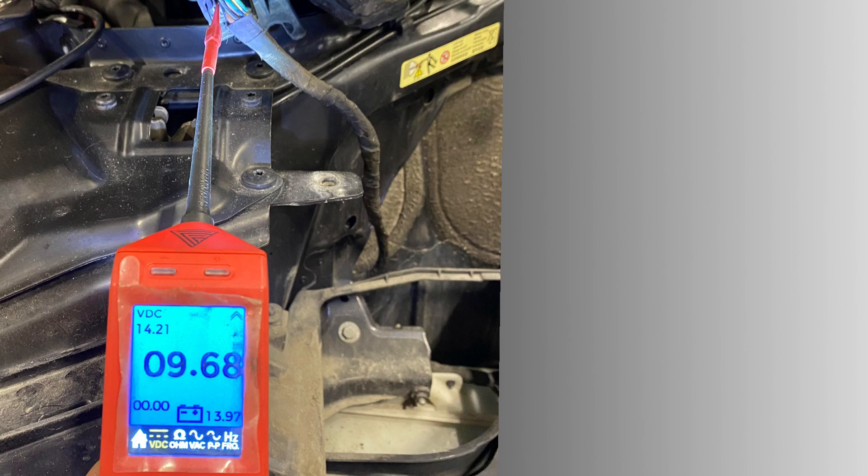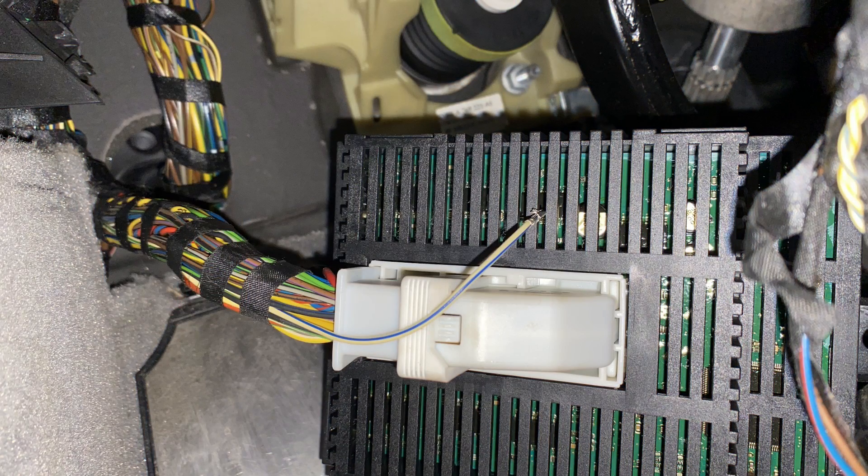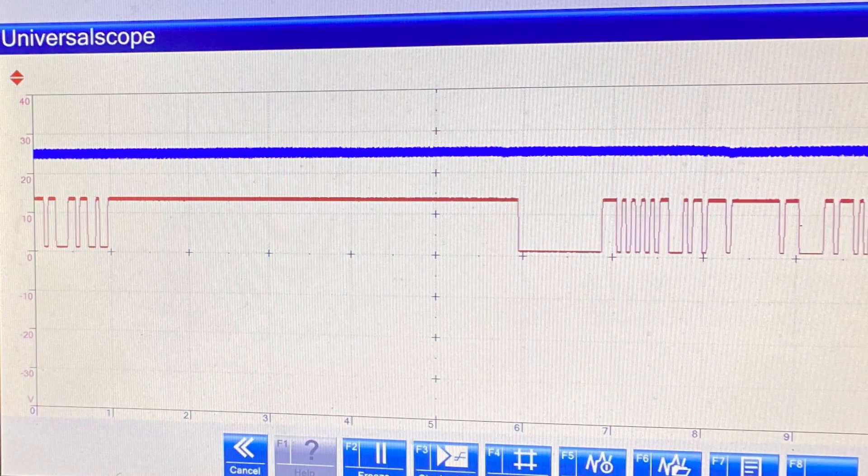Here's the wire on the headlamp module — blue and white — that goes directly from the headlamp module in the car to the back of the headlamp. Inside the headlamp you have a hard wire from that connector down to where the SMC module interfaces, which powers the SMC module's LIN bus system and creates a path for the signal to move up and down. The red trace shows a very nice LIN bus signal on our working right headlamp, and the blue one is a complete flat line at 12 volts.